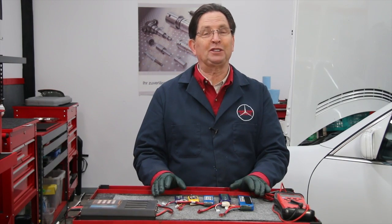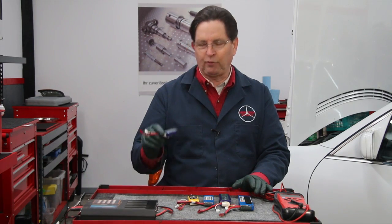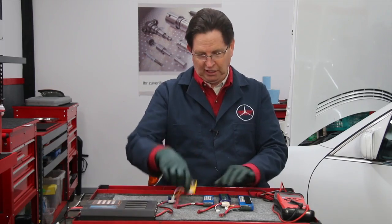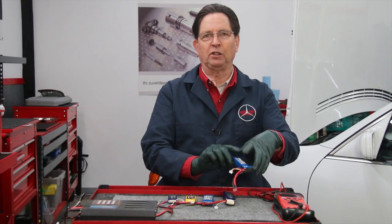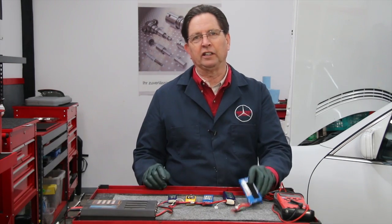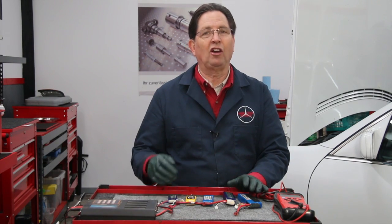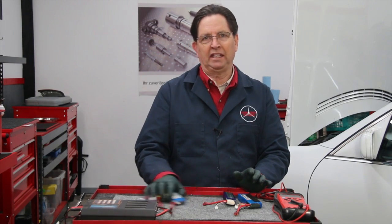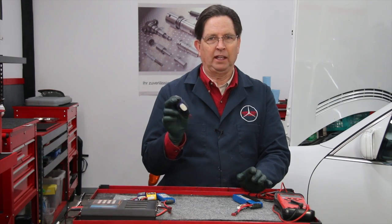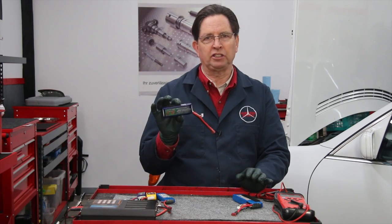There are a number of different sizes of three-cell batteries, and they're all rated by milliamp hours. This is a 450 milliamp hour, this is a 1000, this is a 1500, this is a 2200, and then of course the one I showed you earlier is the 3300. Any of these will work, but the smaller ones won't give you much longevity if you're testing anything substantially. I recommend at a minimum a 2200 milliamp three-cell battery. This is a very common battery among RC enthusiasts.